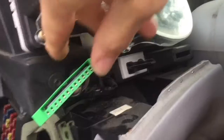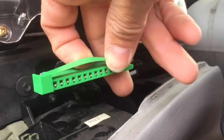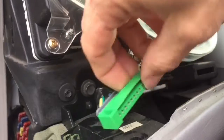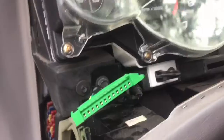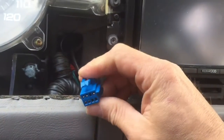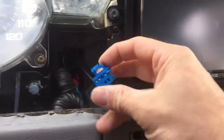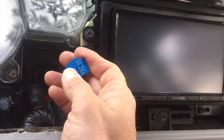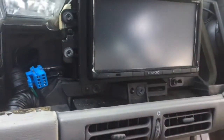The first one is the light switch. To remove this, put a finger in here and just barely pull up on this plastic piece, and you can just pull it out. Or you could pull on the wire slightly because it takes almost no pressure to remove it. Next, come over here — this plugs into the traction control or the trip reset button. All you'll need to do is take some sort of tool, a flathead screwdriver possibly, push in on that and pull the wire out toward the front of the vehicle.